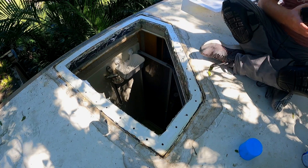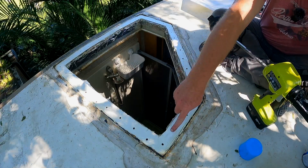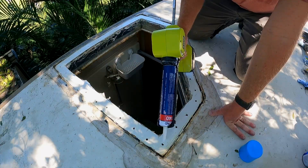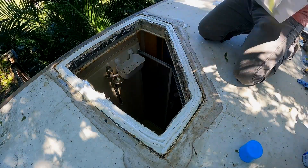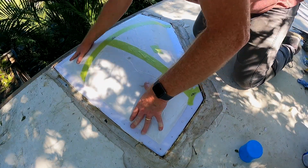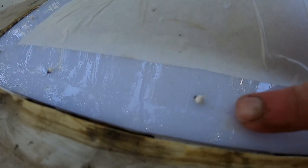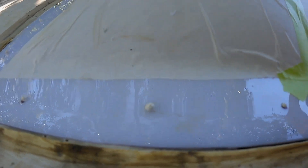It is butyl time! We're using our sky and window butyl sealant. One row is definitely going to go over each of these old holes because I want them to be filled up. If you can see this butyl coming up through a hole, that means it's in there. All the way down the row - each one of these holes has some plastic from the drilling in it.